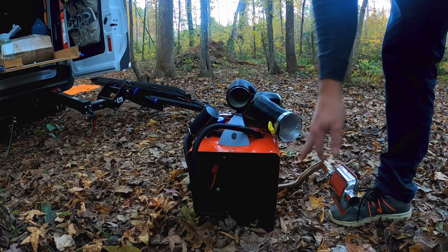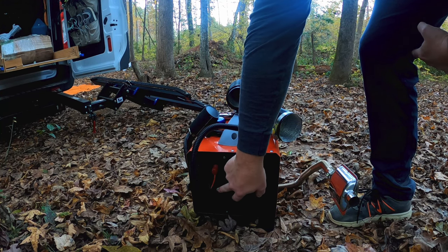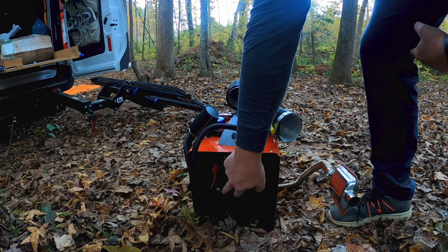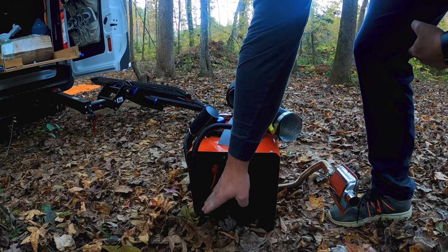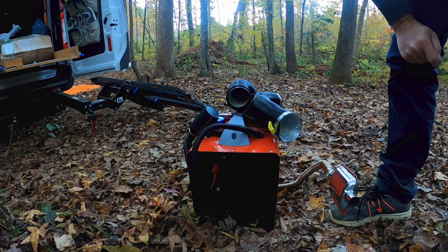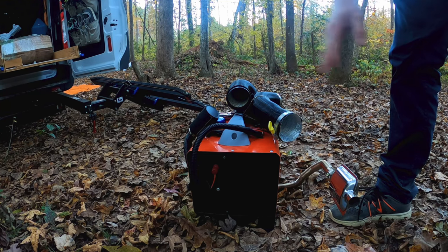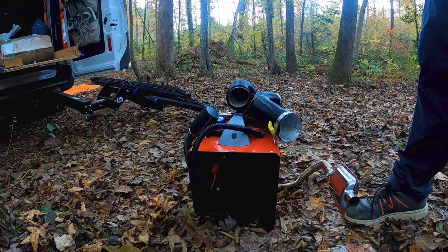take all the screws off the case, remove the case, and take a look at where your fuel pump's mounted. The fuel pump is the thing that's actually pumping the diesel, and it's kind of a piston type fuel pump. If you look on the inside where it's mounted, this is the bolt that's actually mounting it. Mine was mounted kind of catty corner like this, and the casing was laying across the hot terminal of the 12 volt input there. So I took that off, I repositioned it, I insulated it, put it back in. Yeah, probably would have never caused anything, but just in case I moved that.